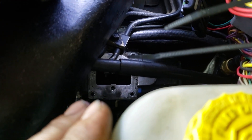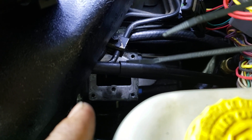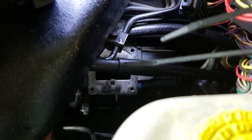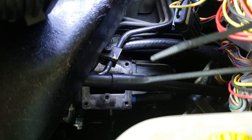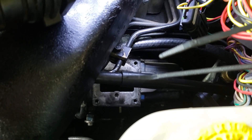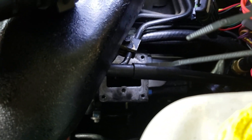When putting these back together, people may curse at me, but I just put three in instead of four because we have the fuel shut-off solenoid over here so it has to be properly sized. This is soft aluminum so don't strip them out. With three screws I can pull this and modify it without having to pull the intake horn and the injector lines.